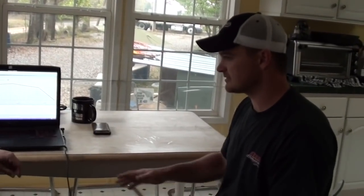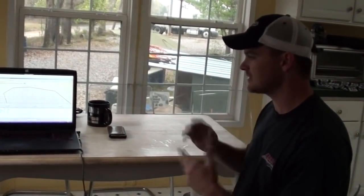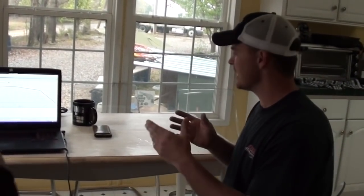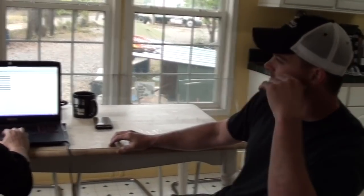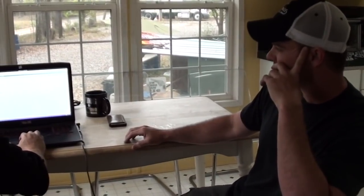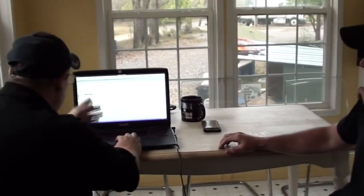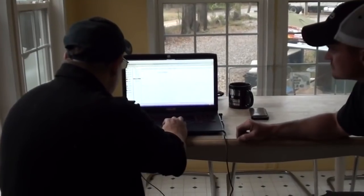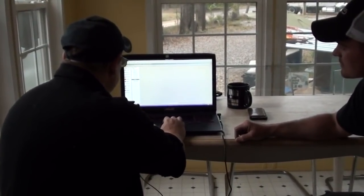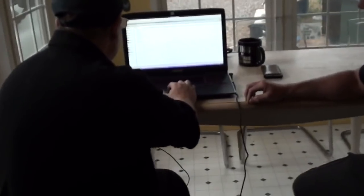Running flat ground at sea level has a lot of benefits. For my situation — short wheelbase, 355 rear end ratio — I want to be at a good RPM and be happy with that. It works good now, though it might not be ideal pulling really heavy loads on steep grades; 1,600 to 1,700 is where you want to be when pulling hard. The truck has one derate for oil pressure in its past, and an RPM derate for oil pressure as well.